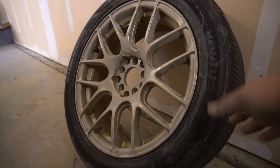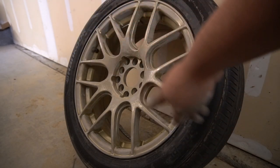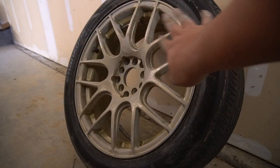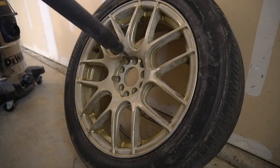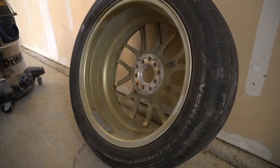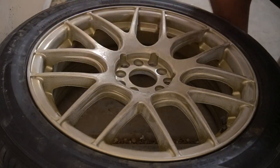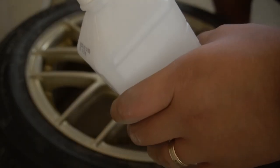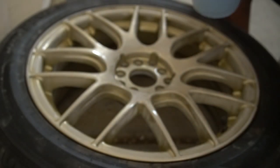As you can see here we have the wheel against the garage wall. We're going to go ahead and get a little vacuum and blow all that sand dust away. Then we're going to go ahead and start cleaning with some rubbing alcohol. Alright, so next with the air blowing off all the powder, we can go ahead and get this alcohol and some shop towels to clean all the surface areas and make sure we have a clean surface ready to go into primer. Let's get to it.